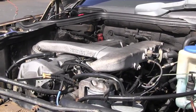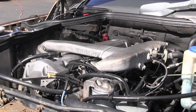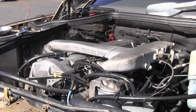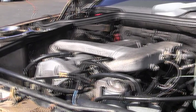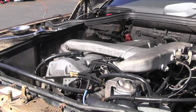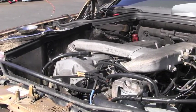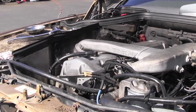You might say I'll just bump the starter and the engine will rotate for me, but let's say your starter doesn't work or the battery is dead. Or you just need a fine rotation — like finding the TDC — or maybe you're trying to empty the automatic transmission torque converter and you need to align the plug with the hole on the bottom.